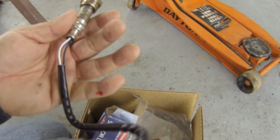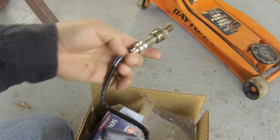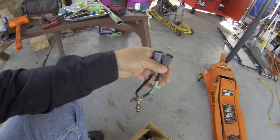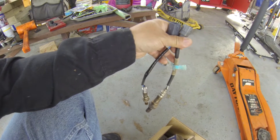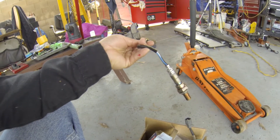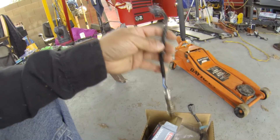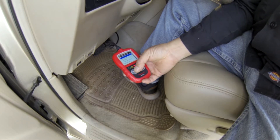The plug is the same. The length is probably a little longer than the OEM one. If I went to Lexus they'd sell me the exact OEM length, but this is a cross-match so the length doesn't really matter as long as it works. At 30 to 40 dollars for a Denso O2 sensor, that's all I need. I'll put it in, reset the code, and see what happens.